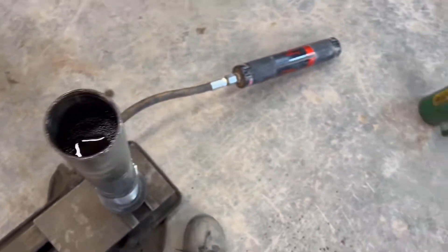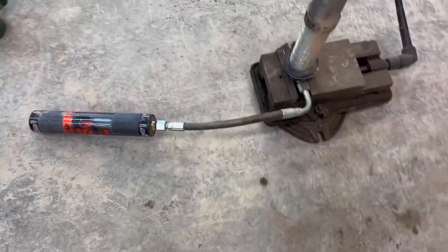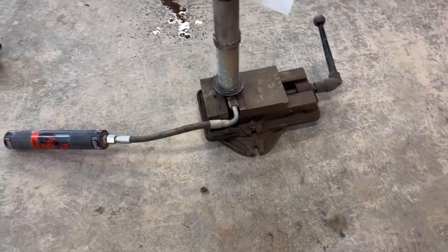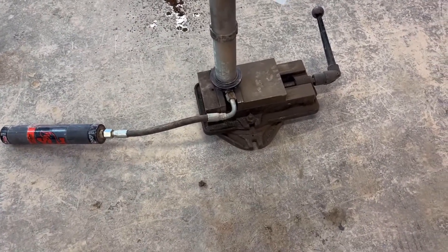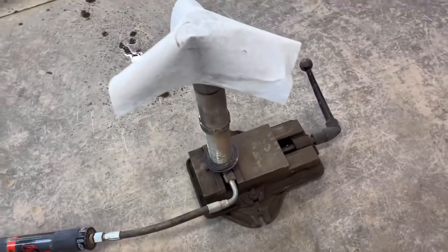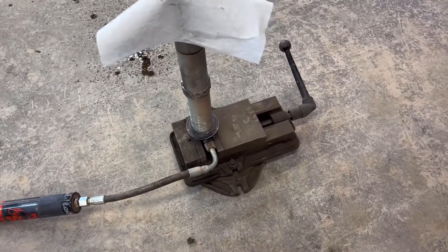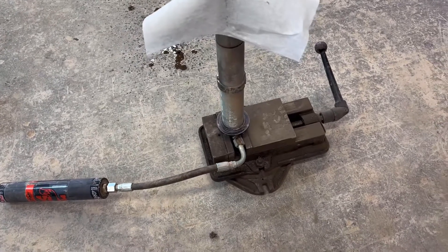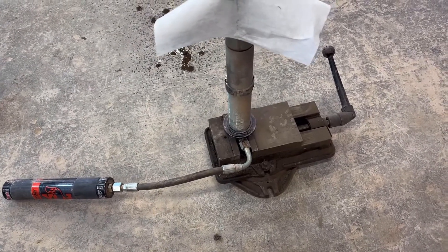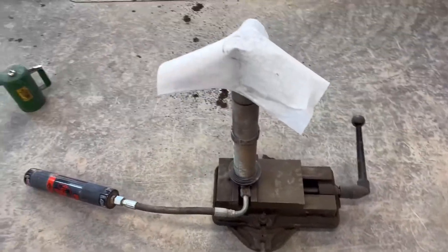See, it's full of fluid. Now there are two different common types of coilovers: one is an emulsion coilover and the other is a reservoir. This one has a reservoir, and basically what that's for is you have a 7/8 inch diameter shaft going in and out, so you have to be able to displace that amount of fluid. An emulsion shock has the nitrogen gas mixed right in with the shock fluid, so when that shaft goes in the nitrogen gas can compress — but it's not as efficient because it changes the way your shock operates since there's gas mixed in with the oil. The best operating shock is going to be just pure oil, and that's what the reservoir is for.